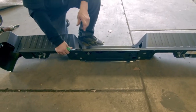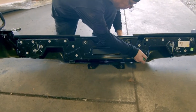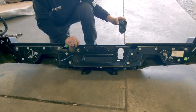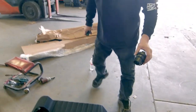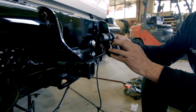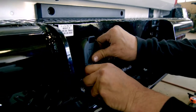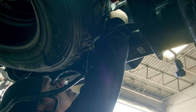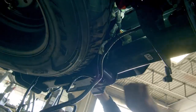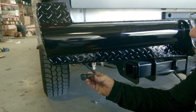You can check the connection by turning on the headlights. Next are the sensors. Pop out the seven-way connection plug that snaps into the hole in the factory bumper — it then snaps into the new bumper to the left of the license plate area. Plug the existing wire from the seven-way plug back in. There are four sensor holes on this bumper. First install the rubber grommets that came with your installation kit, then install the factory sensors that are part of your truck.